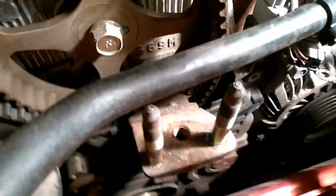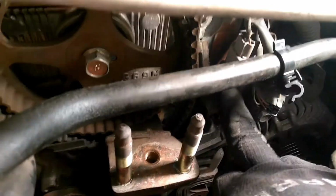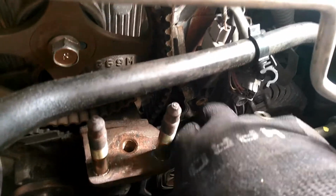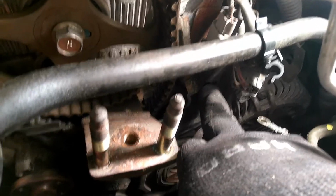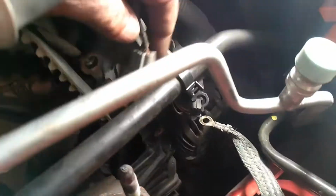Another thing that I can't stress enough, that's a little bit different about this car, is right here you have all these little connections, right? But this connection here, and if you look at it, you can tell which one it is, this one right here. On this car, it's really weird, because that is your plug for the crank sensor. It has internal wires that go into the plastic. It's built into the plastic on the bottom timing cover. So you want to make sure that you unplug this right here and be gentle with it before you start trying to take the bottom cover off.